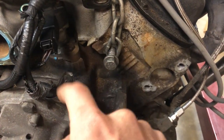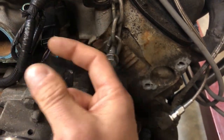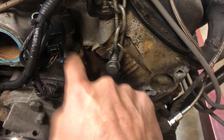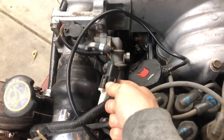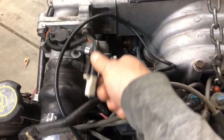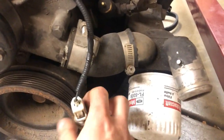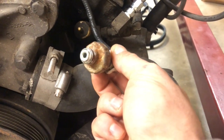The harness that's in my truck, which originally came with this engine, had the three-wire cam sensor. So you can't just swap the top — you have to actually swap the whole thing because the shaft has a different pattern on it. I swapped my old harness to the two-wire and just left the third wire dangling. This harness came out of a 2000. Things I've already addressed on this engine: the TPS — the later TPS has a plug that plugs right in, whereas the earlier one has a flying lead. The oil pressure sender also has a different connector plug on the later harness versus the earlier sensor.